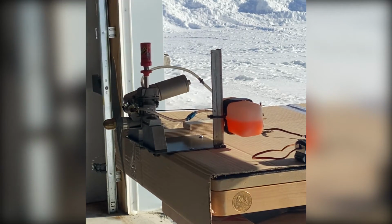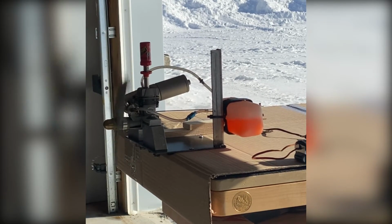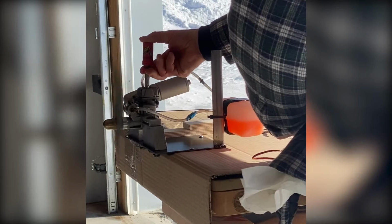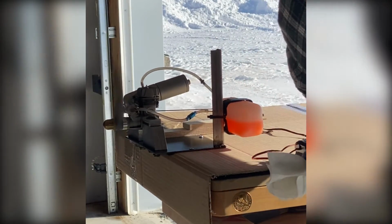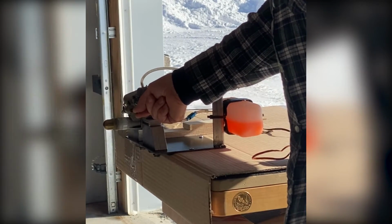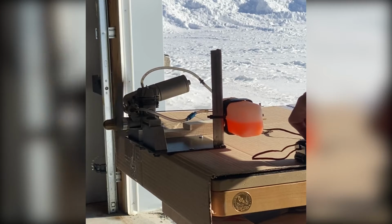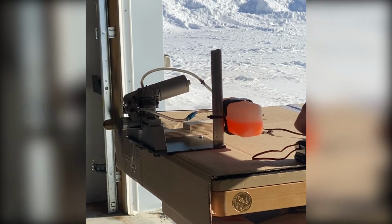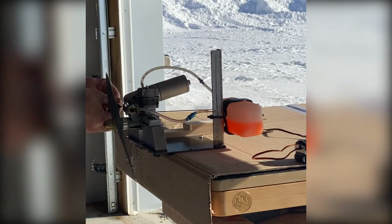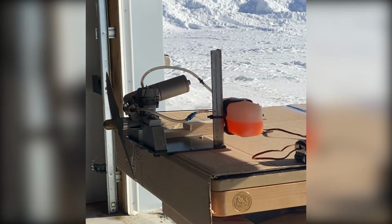After some running is accumulated, some run time, I like to start trying to lean out the low end needle, very, very small amounts, maybe a 1/16 to an 1/8 of a turn of the adjustment screw. We'll check the transition while the engine is warm, and kind of ease up on it with small adjustments. Every time you run the engine, you can check it a few times. Eventually it'll get into a clean transition, and the more time the engine accumulates, the more reliably it'll idle and transition into a mid and high speed run.